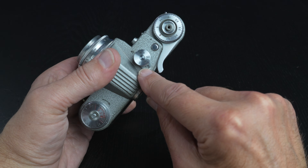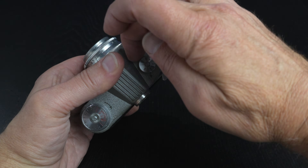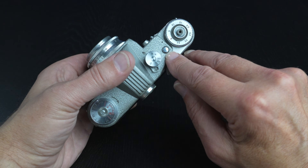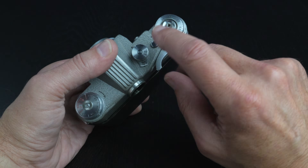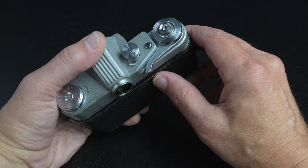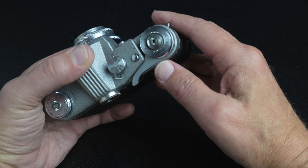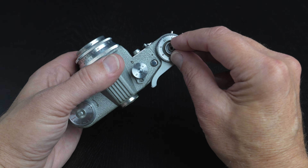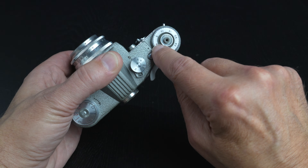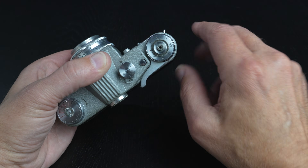Around the shutter speed ring is the sync for the electronic flash or, at the very top, bulb — to synchronize the shutter with bulb or electronic flash. The next button over, which looks like a shutter button, is actually the button to release the film so that it can be rewound — that's a film release button. Moving to the right is the lever to advance the film, which is quite an improvement from earlier Zenit models; prior to this you would use the round knob. Within that circle are numbers indicating the number of exposures made, set to zero at the beginning of the roll. The shutter button is also threaded for use with a cable release.